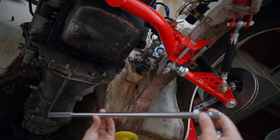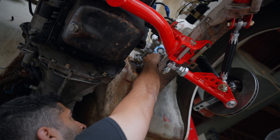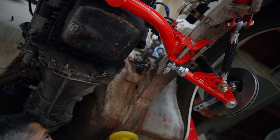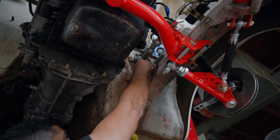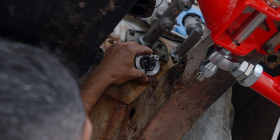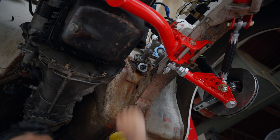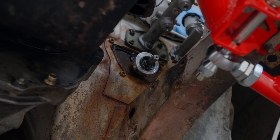First I'm going to go with the supplied spline shaft, making sure the spline engages. You can see it turning really nice and freely. Then we place the clamp right where that bearing is and align the slots in the clamp with the slots you already cut into it. Now we have a nice tight steering shaft — it doesn't move but it spins nice and freely. As I turn this, it turns nice and smooth inside, just like turning a steering wheel.